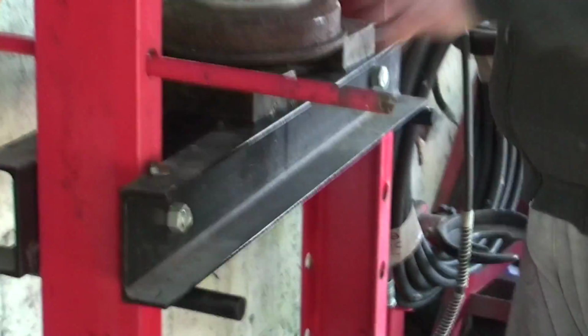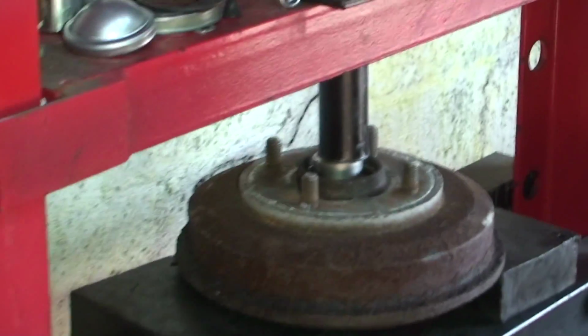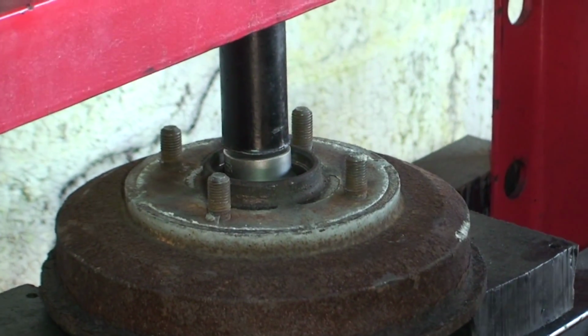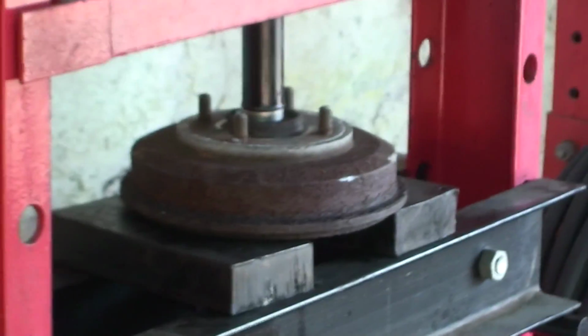Now with the press, it's important that you make sure you're getting an even press. It hasn't gone in sideways or anything like that. So when you get close, you want to line everything up. Make sure there's nothing blocking it from underneath from coming in. You want to get these in as far as you can without going in too far, which is fine there. I can now press this and see if it comes out. Now, that initial crack, that's what you want to hear. We know we've cracked it now, and this should come out really quite easy now.